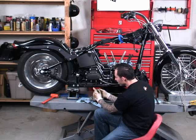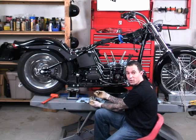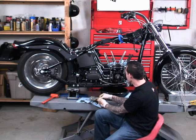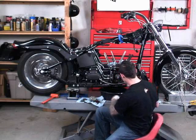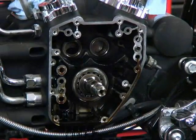So I'll put these back together. You want to make sure you put a good amount of assembly lube in there, because when you first fire it up again it's kind of dry since we've just pulled all the oil out of it. Make sure it's as lubricated and oily as it can be so you don't have any startup problems. After I put that back together and reinstall it, we're going to remove the cam bearings there in the back of the case.